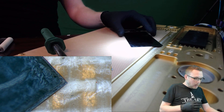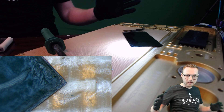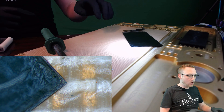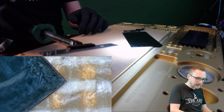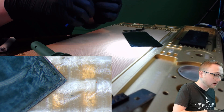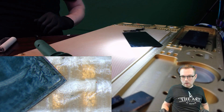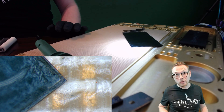There we go. When you look at these things with your naked eye, you can't really tell where things start and stop. This is one continuous thing — how am I supposed to take it apart? But if we look at it in the microscope, we see that the display panel actually goes out a little bit farther than the polarizer itself. So I'm going to take my fancy number 10 blade here and — look at that — it really does go past it a little bit. That alone should give you your first tip: the corner is the weak spot.